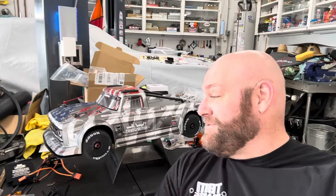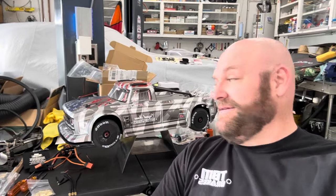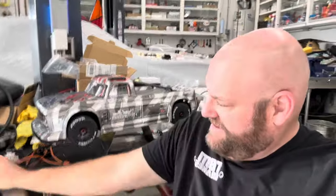It's time for another awesome upgrade on this Infraction. If you were watching our other video with the DBXL, you saw we upgraded that thing to a Max 5 and pulled the ESC out of that. It's basically a Max 6 — same size, everything. What I was thinking of doing, and other people have done too, is putting the Max 6 in this truck just to keep things cooler, especially as you throw a bigger pinion at it. So I've got that guy out of the DBXL and it's ready to go. This is going to be a really easy job — stay tuned.